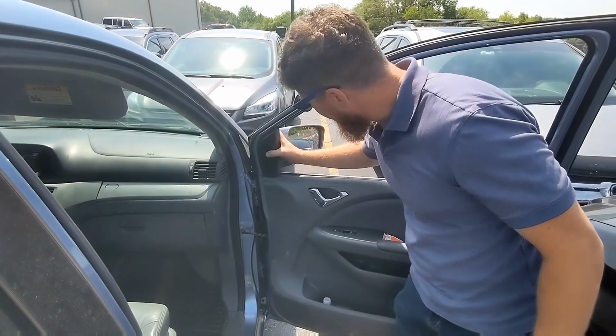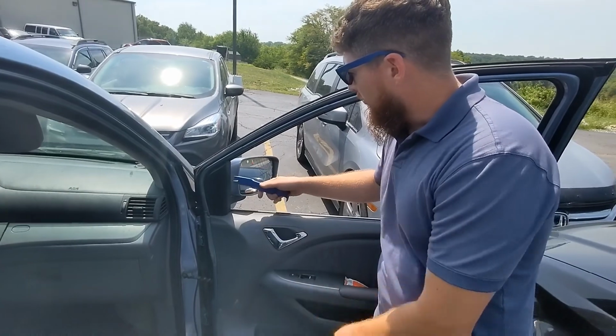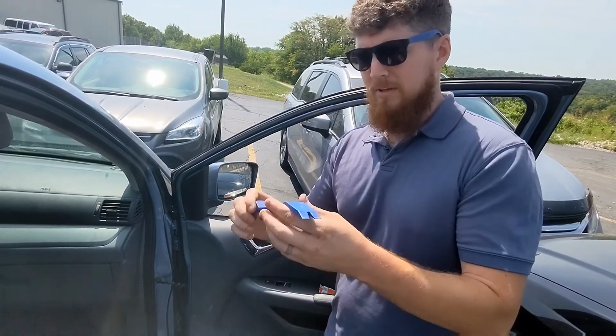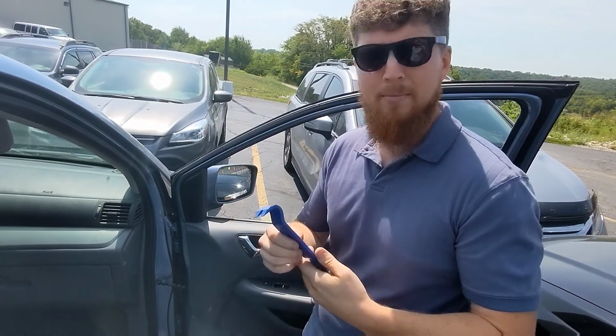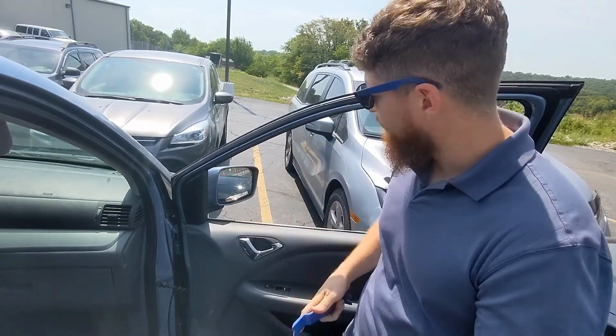The first thing we're gonna do is remove this black plastic panel. It's just got a few clips in it. What you wanna do is work behind it and pop it out. I suggest you use a plastic tool, something like this. You can get an interior plastic tool kit at Harbor Freight or on Amazon. I'll throw a link below to a $5 kit just in case you wanna grab one.